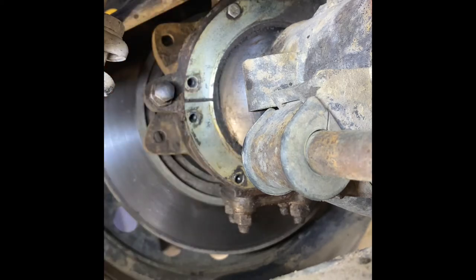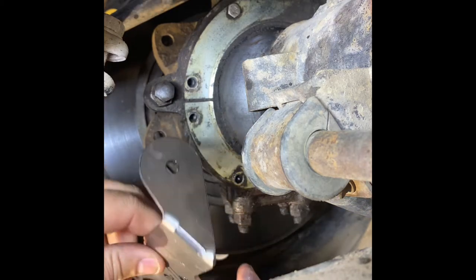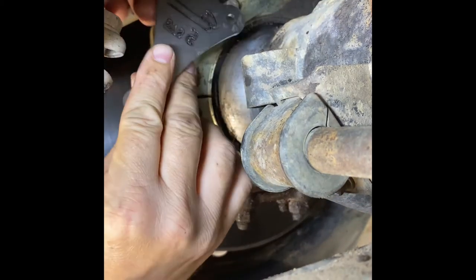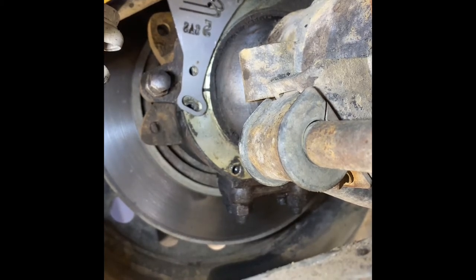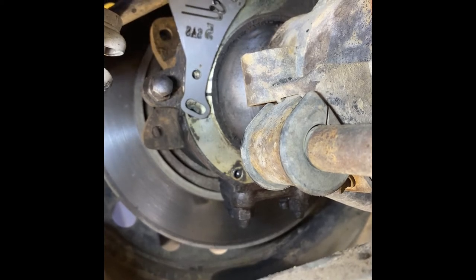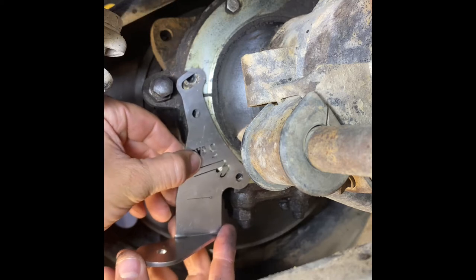There we go. And I'm going to be running these in the down position. They can actually be run either up or down. We need the corresponding side, but you can see that the bolt pattern will work for either. What this means for me is that I think there's going to be a poor light cutoff and I'm not going to get as much use out of the lights. So I'm going to be running them in the down position, which I'll put right about here.